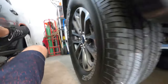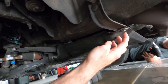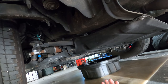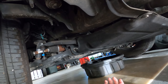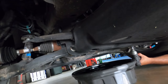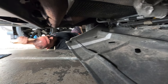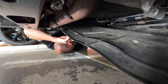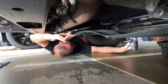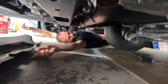Underneath these EcoBoosts there is an air deflector panel. You have to take off four 8mm bolts to take this panel down. The bolts are caged in the cover so they won't come out completely — sometimes the retaining tab doesn't stay. Just pull the panel all the way back out of your way.